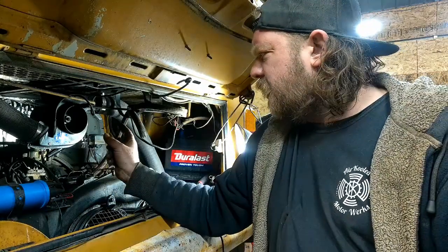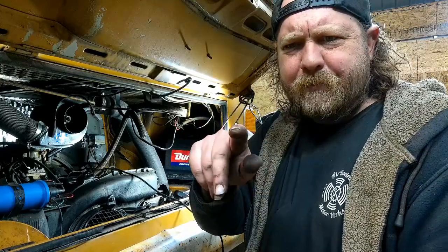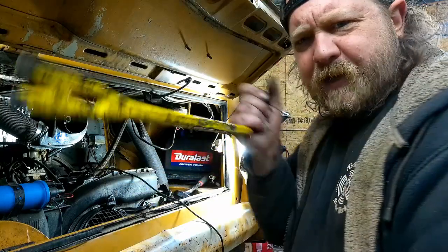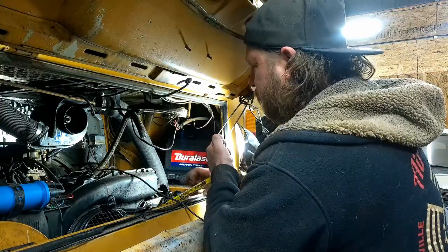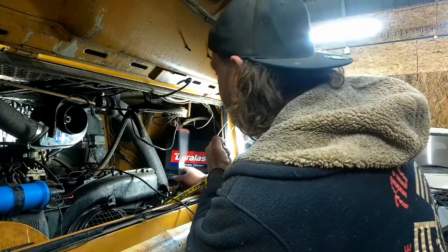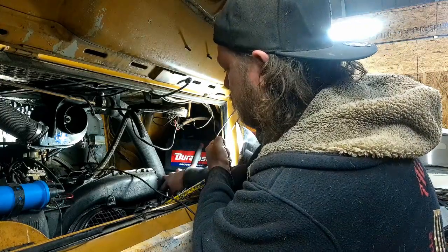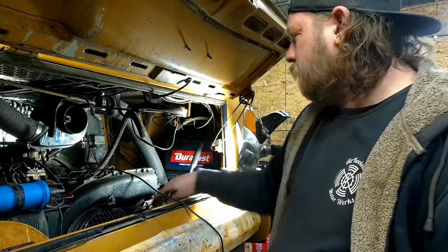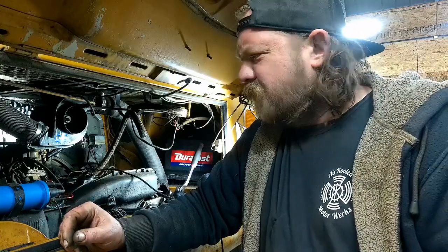So plugs are changed. The only thing I want to do now, or really all I have under here, is replace the fuel lines and the fuel filter, because they look not the greatest, and tighten this alternator. It's 6 mil, at least on this one, up top, Allen. Give it a little loosen. Shove your handy dandy pry bar in between the case. Be gentle and give it a little bit of a twist down and tighten. Oh, is that stripped? And take out the slack, so when you rev it, you don't sound like you've got a crazy supercharger.